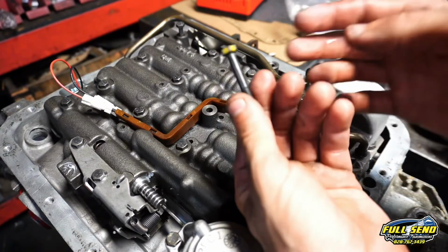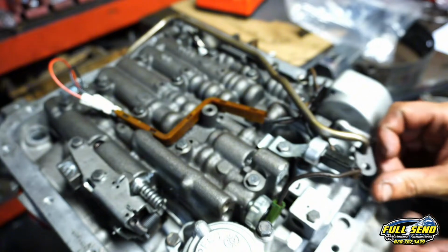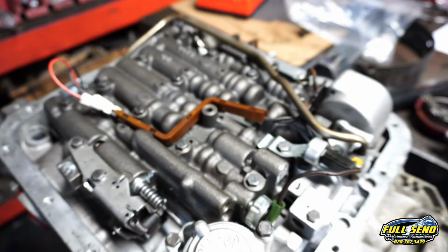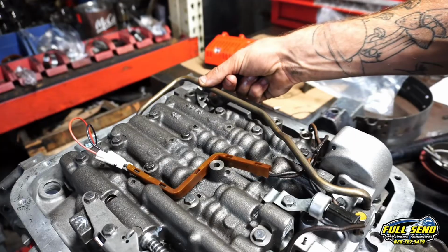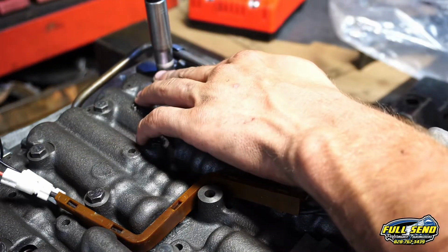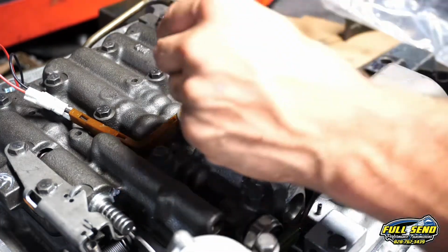Okay, this is your yellow bolt that goes into your auxiliary port here, and here is your little bracket, one of the two, that holds on your auxiliary hose. The other one wraps around the hose back here. That valve body bolt sits in there just like this. Now, this is all set up properly. We need one more bolt here and our washer to hold our wire harness into place.